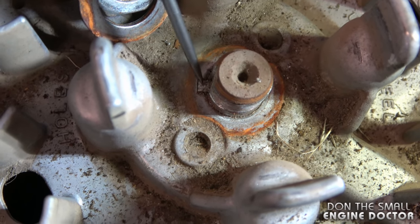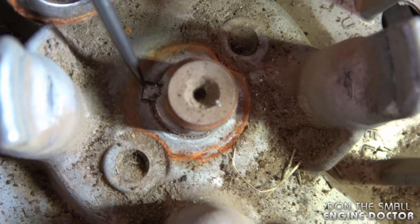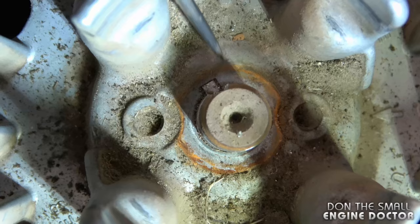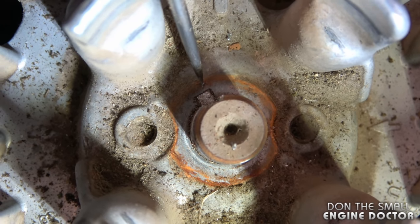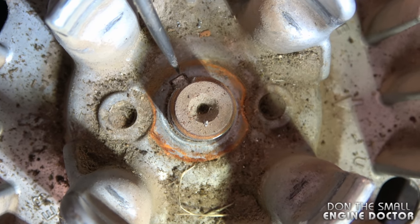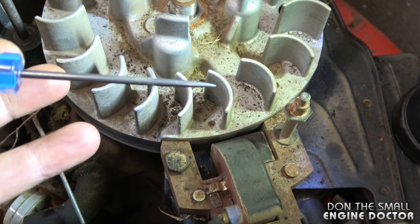This flywheel key here is good. However, if it was sheared, you would see that the notches would not line up — you would notice that the flywheel key is off from the keyway hole on the crankshaft or the flywheel. So if you've hit something hard and your mower runs rough or vibrates, you don't need to take the flywheel completely off. Just take the nut off the crankshaft, have a look at the flywheel key, and see how it lines up with the keyway hole. If everything lines up like on this one, you don't have a sheared flywheel key. If everything is offset, you do, and you should replace it. A sheared flywheel key throws the ignition timing off, which is why your machine will run poorly, rough, or vibrate.